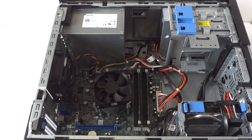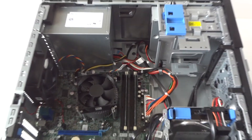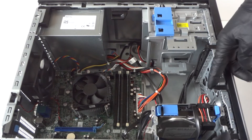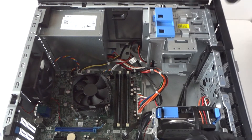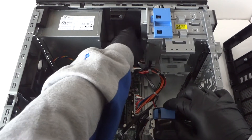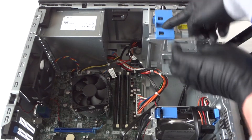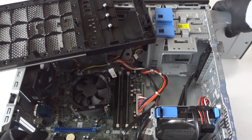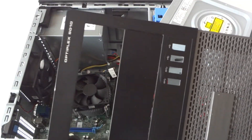The last part is the optical drive. Remove the front cover bezel — there are little clips; press them gently upward with your finger to release the bezel. Then disconnect the SATA power cable from the optical drive. Press on the clip to release the optical drive and it slides right out on the right side. This is for the Dell OptiPlex 9010 mini tower.